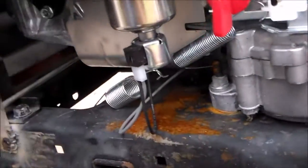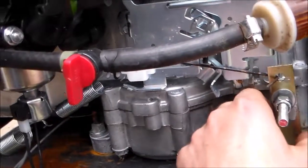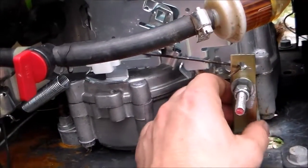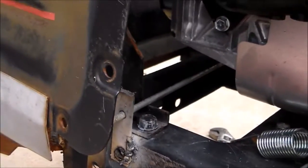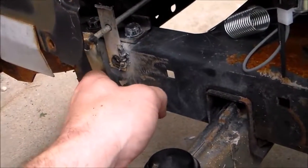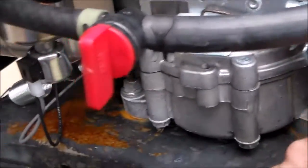Either way, made some good progress today. Got two return springs that basically pull here and automatically go back to where it was — just like so. Now I've got a mechanical linkage in the works: this piece of all-thread pulls here, which pulls there, which in turn pulls there again. Basically a rod from here to here that pulls, opening the throttle.